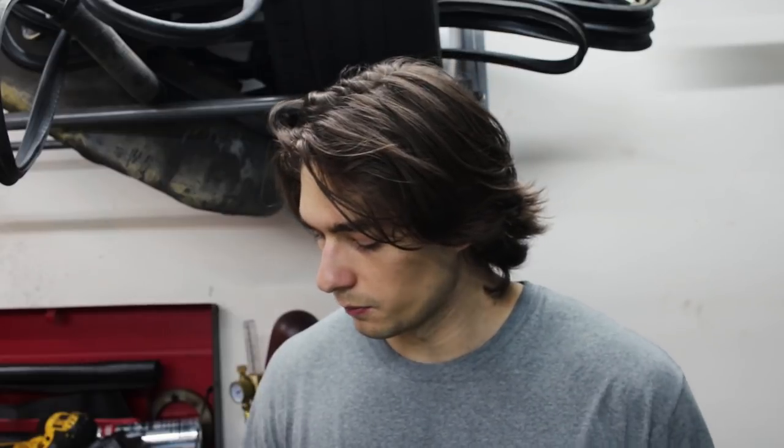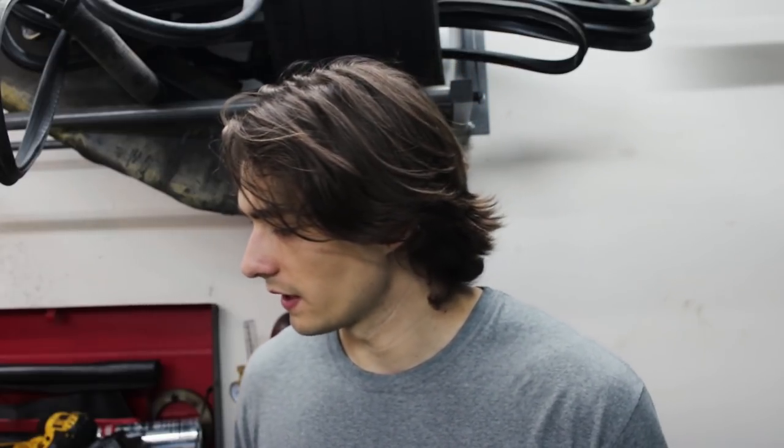There wasn't really a lot of reason for me not to buy this, except for that little bit of rust in the front. That's already gone, like you guys saw. Just to recap, we fixed that rust. We cut the front fenders, we cut the rear fenders. We pulled the skins out, welded up the skins to the outside. We deleted the rear antenna, deleted the rear wheel well with the Garagistic piece, drilled some holes in there. And the sunroof, deleted the sunroof, pulled the whole cassette out.